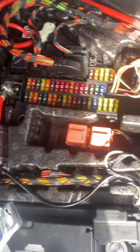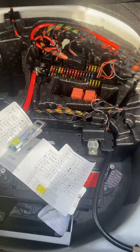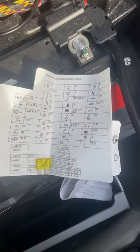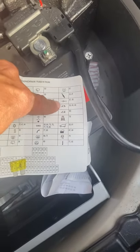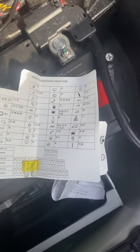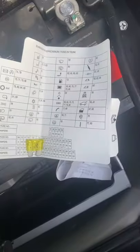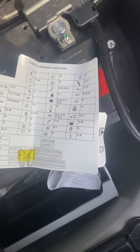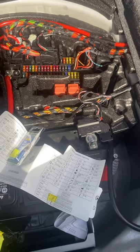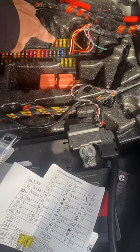I think that should do it. I sure hope this helps you guys, because I was dumbfounded and the young kid at the auto parts store yesterday was of no help — he didn't have a clue. So reading this map again, this is your cigarette lighter direction. The rest of these look similar to what you might be looking for, but the cigarette lighter did not. I'm so thankful for the person on YouTube who helped me figure out that this was it. So if you drive a 650i and need to replace your cigarette lighter fuse, it is in slot 87, right here.